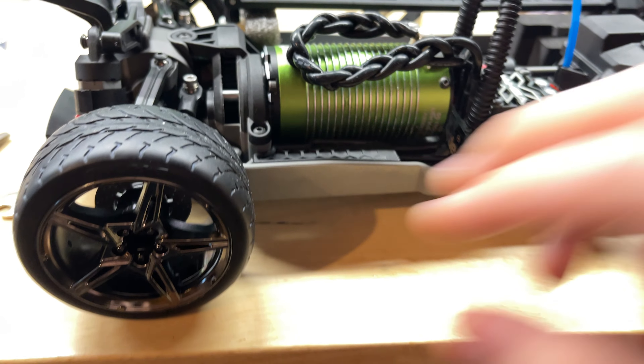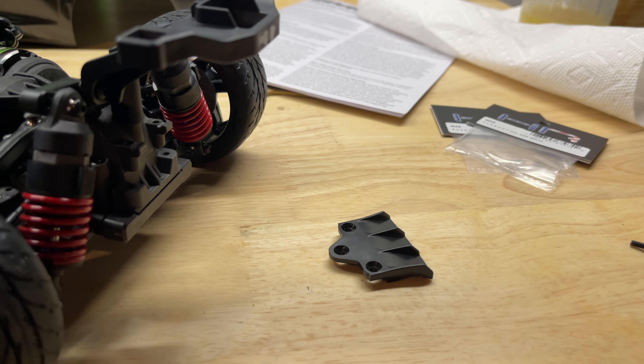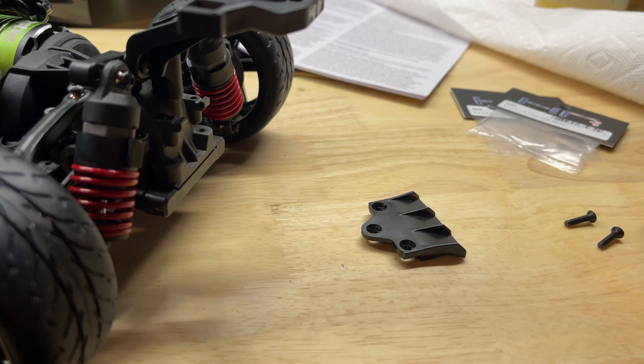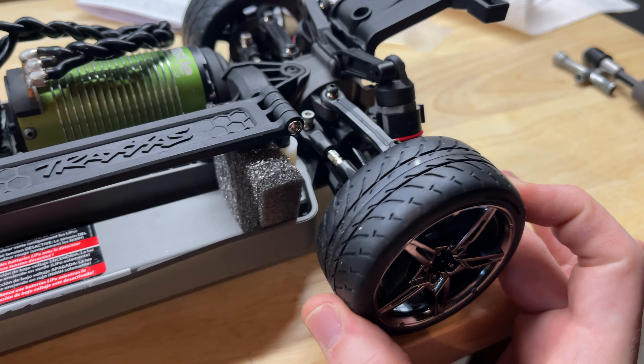You can see it did help out a little bit on that arm, so I'm going to do the same thing for the rear. The rear is even easier — two screws on the outside, the middle one is a little bit shorter, and same as the front it just slides right off. We go ahead and add our shims. Grabbing just the arm, that thing is really really stiff — really happy with the result. Shimming your arms and pins is a completely underrated step of this process.